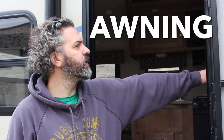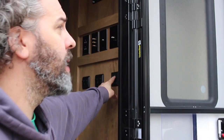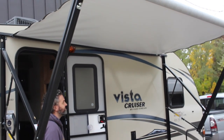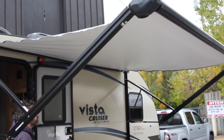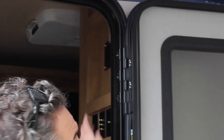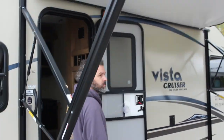To operate the awning — it's a power awning — use that first button as you walk in the door. Push it up and the awning will start to power out. A few important notes: if it's windy, don't put the awning out, as a gust of wind can twist it. Don't try to move the unit with the awning out, and don't place any heat source underneath it. The awning also has speakers at the ends for playing music outside, and a light display controlled by the second button. To retract the awning, push the button again and it will power back up.